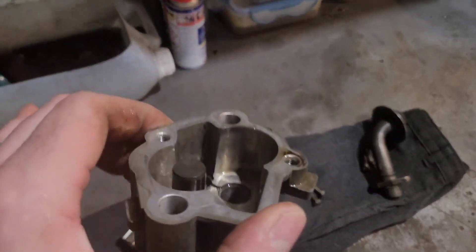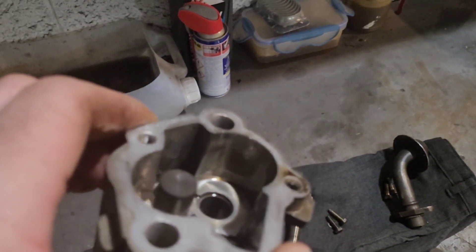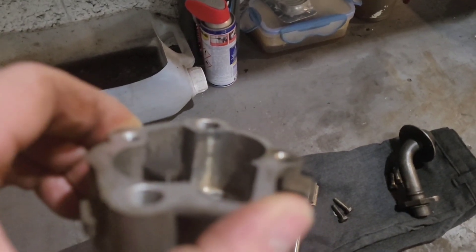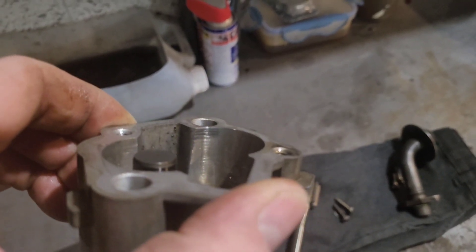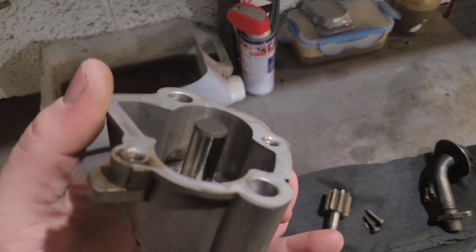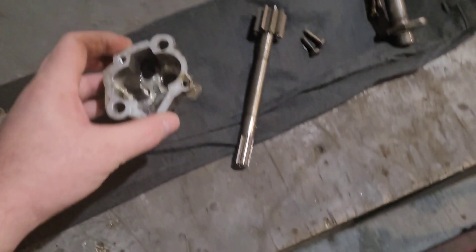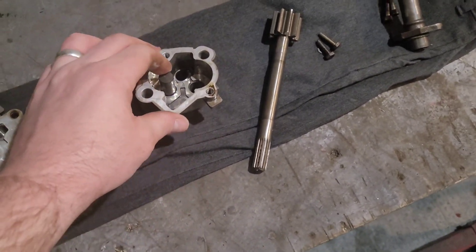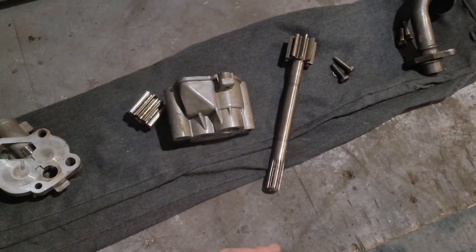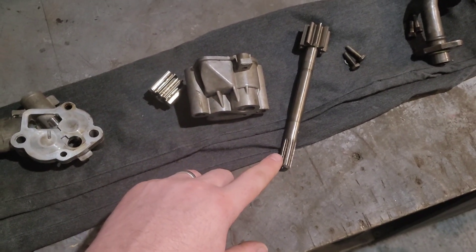So it's not going back on - that's why I'll stick to an OEM pump. That's why I don't like aftermarket pumps: they'll do the job, but doing the job doesn't mean it's the right part. Sometimes OEM is the best. It hasn't really been catching much on that one mainly because there's no leverage on that lug - there's leverage on this one because it sits at the pump, so you've got all that leverage and it will move around because it goes on the auxiliary shaft.